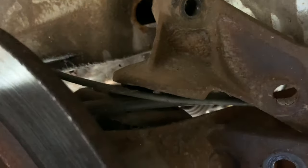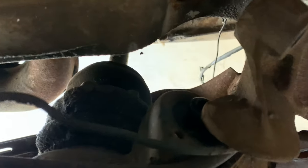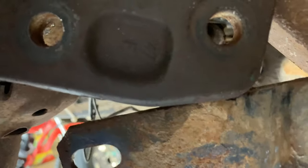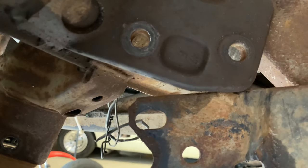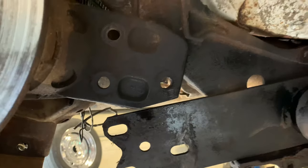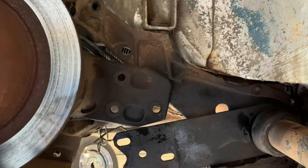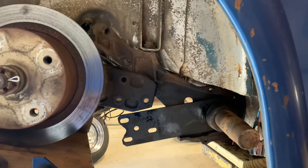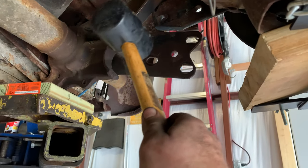I've got the bump stop all the way against the rest there. You could trim off a little bit back there, or you can trim just a little bit right here to allow it to slip past — it almost does, but it doesn't go up quite far enough. The easiest thing seems like just trimming off a little bit of that plate, since it seems like the strongest piece. So I trim just a little bit out to give me plenty of movement there.